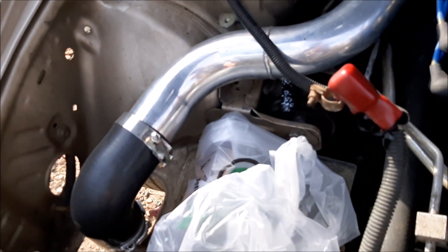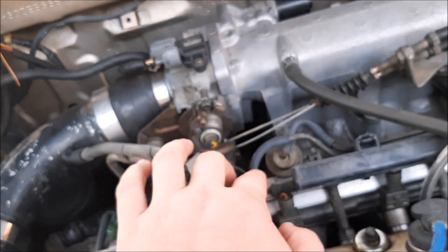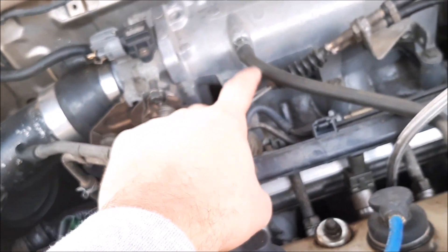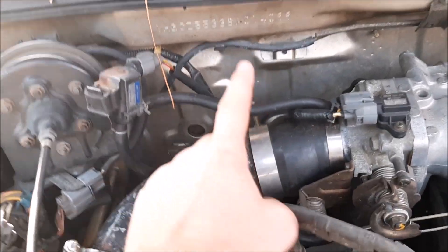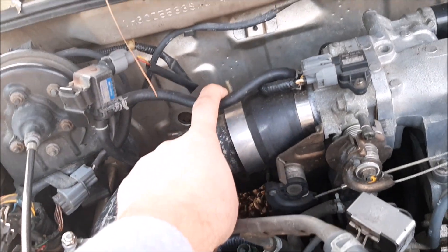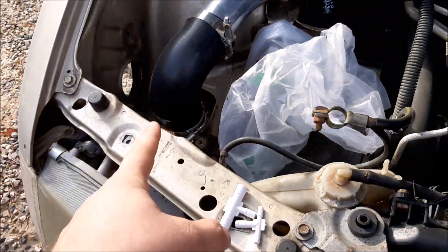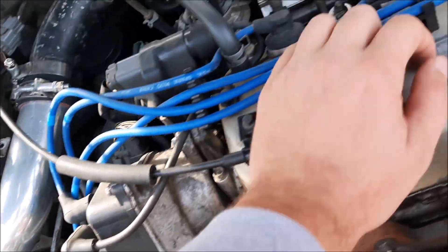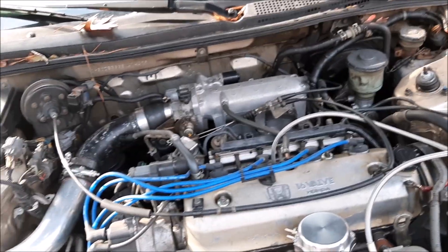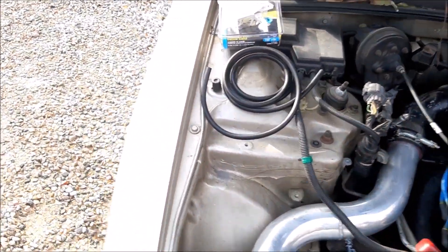I got some vacuum line tubing from the store — nothing special — and a whole box full of vacuum tees. What I'm gonna do is grab a vacuum source. Some people take it off where it goes to the fuel regulator, but I don't like doing that because it might mess with your fuel regulator signal. I typically go right here — the vacuum line coming off the throttle body. I'm going to cut that, put a tee in it, run that line down to the blow valve, and somewhere in between have a tee going to the wastegate. It's not ideal to tee off an already teed line, but it will work for a low boost application.